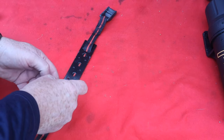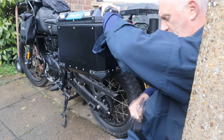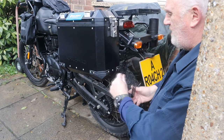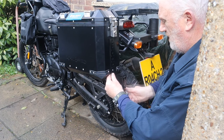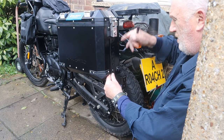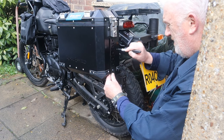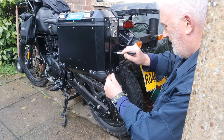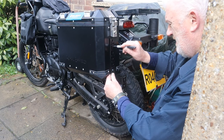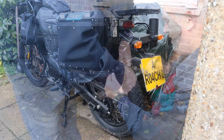So I finally found out the capacity of these panniers — they're 26 or 27 litres depending on who you believe, so they're not exactly the biggest thing in the world. I'm using this rivet just as a locator and I'm going to line it up with the lock mechanism. So we're probably going to have one bolt position there and maybe one here. I'm going to mark the centres, put a little punch in there, and then I'm going to be drilling two holes — and that's how we're going to mount it.